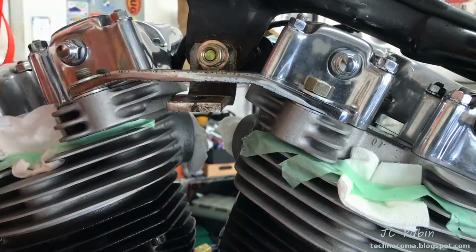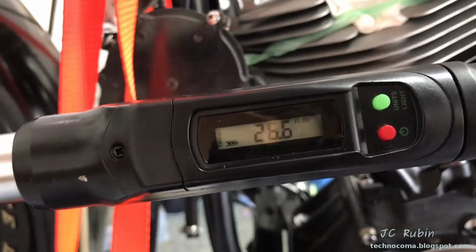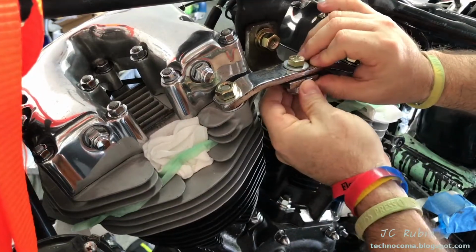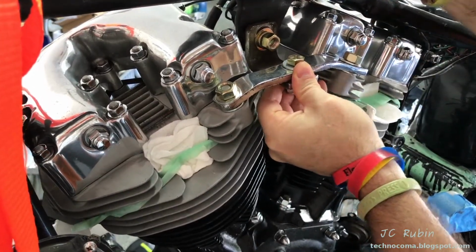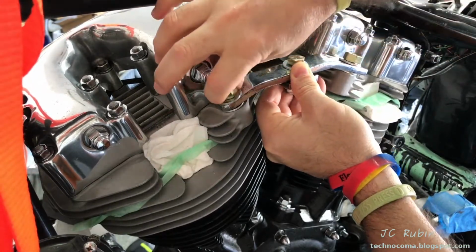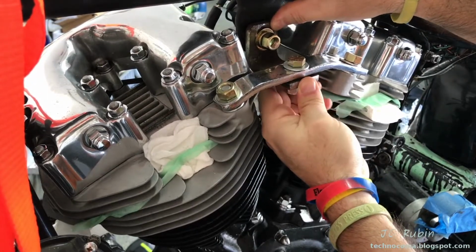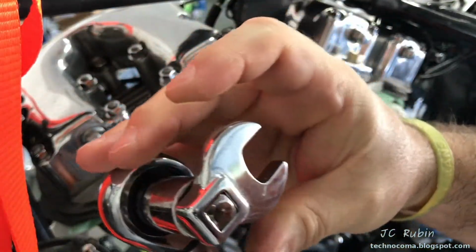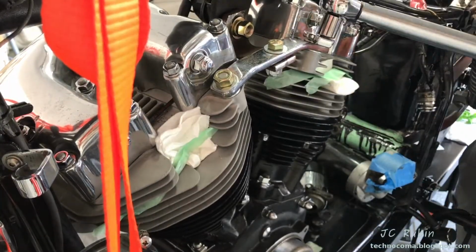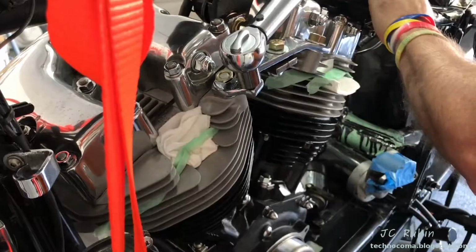So I'm just going to tighten down these nuts. We'll get underway. We'll be setting the torque wrench to 40 foot-pounds. The goal here is to get everything really tight without anything being under stress. So we see everything wiggles. I'm going to hand tighten these 2 nuts first. The rest of the mount is free floating. I'll be using this crow's foot as a torque extender. Of course, it's imperative that the crow's foot is always tightening at exactly 90 degrees to get an accurate reading.